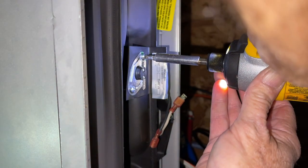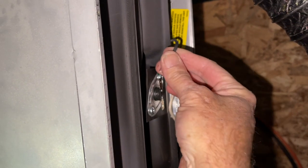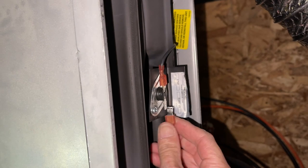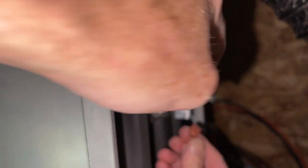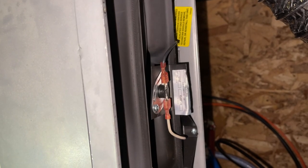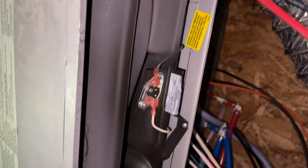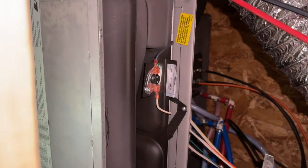Don't over-twist the wire connectors — just put enough on there, then connect high and low. I had to pull out the short wire I'd cut to connect the bypass. Then I went ahead and turned on the heat to see if it fires up — and there she goes, we got heat!